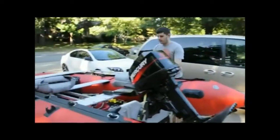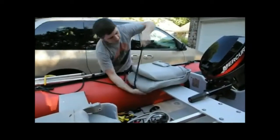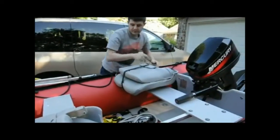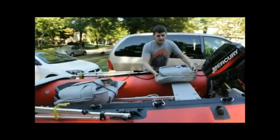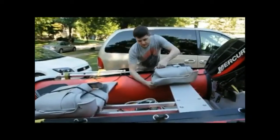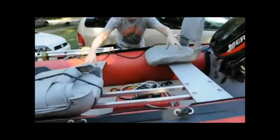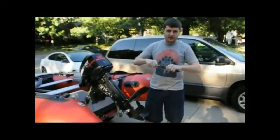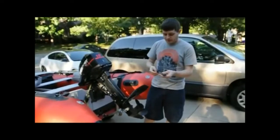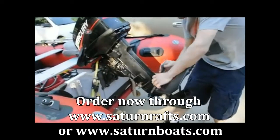The seats easily flap up when driving down the road, so I have a bungee cord that attaches to the bottom and snaps — I do both of them. The seats are mounted with stainless screws from the bottom side up, and to keep the seat from rocking back and forth, I have two aluminum bars that lock the two seats together so they can't twist. You want to use all stainless hardware because it's all going to get wet. There's a bungee cord with a knot in it so I can adjust the tension. There are two holes in the back that it snaps into, then wraps around the back of the motor to hold it down.